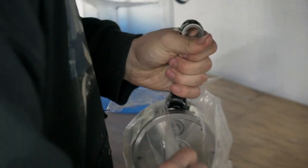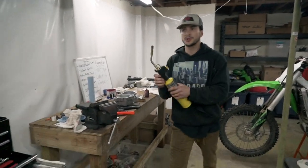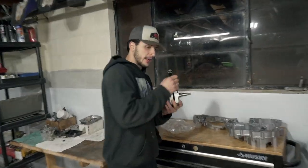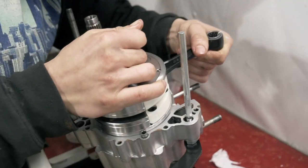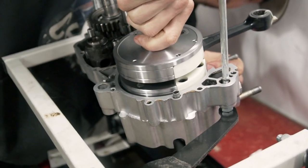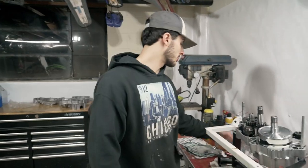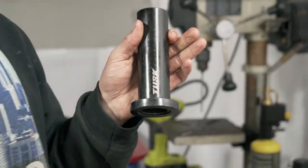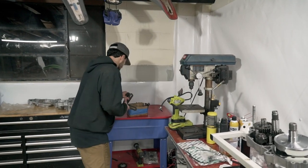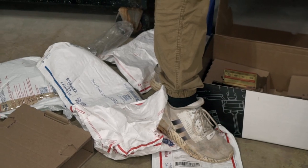Go upstairs to the freezer and grab that crank — it should drop right into the left side casing. The crank is cold. We want to be super careful — heat up the bearing race just a little bit warm, grab the crank, and the left side of the crank case gets the flywheel side. That did not work — I wasn't able to heat it up enough. You don't want to risk heating up the bearing race and ruining the seal. So we grab a Tusk crank puller tool, which basically attaches to the opposite end and pulls the crank through the bearing.